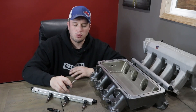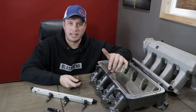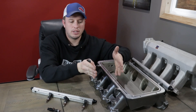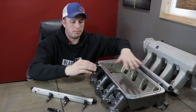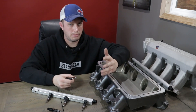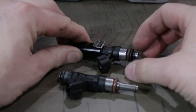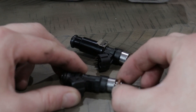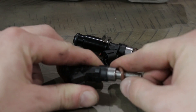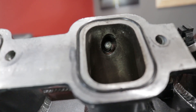That presented a problem to me, looking at the two styles of injectors I have here. I had a packaging issue with this intake — the intake was too tall, so we shortened it. And then we had an air-to-water intercooler with billet water manifolds on it, so we needed the fuel injector rail to sit below the water manifold. What I did is I bought a set of injectors and I took the bottom hats off of them. I was like, 'Oh, this fits' — they were too tall with the bottom hat. The problem I got into is this injector was never made to have that hat removed and be run, especially with an injector on the bottom. As you can see in this video, the injector can move back and forth and easily get past the ledge, and the O-ring can easily get past the ledge that's on there.